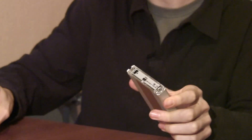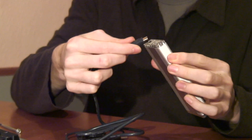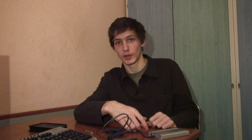Now that you're done, to connect the hard drive to your PC, just use the cable that's supplied. Often this will have a small end to plug into your hard drive, and one — or sometimes two — ends to plug into your computer via the USB ports. Once you plug it into your computer, before it functions correctly, you may have to use a driver CD which is delivered with the case. But in most systems using the modern version of Windows, you won't even have to do that — simply plugging it in will be enough.